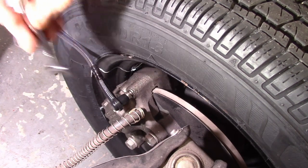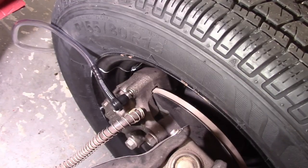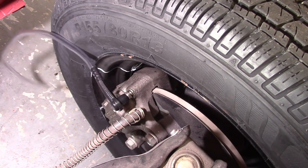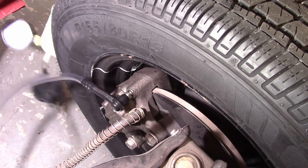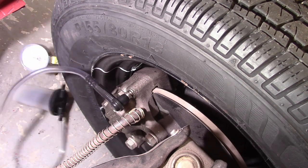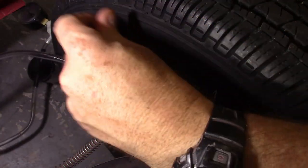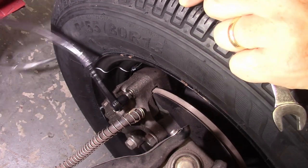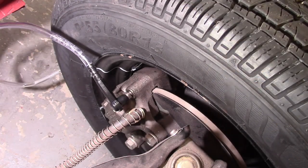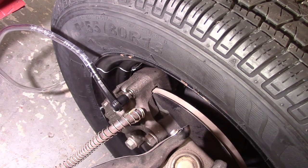So now, same thing, last side, pump it up and get some vacuum in there and then just continue to bleed. This is pretty straightforward, pretty easy. I'm drawing about 20 inches of vacuum or so before I bleed it. All right, getting pretty much continual flow out of that. Master cylinder's still got a little bit in there. So I'm happy to where that one sits, and I'll go ahead and vent this thing off and take it off.